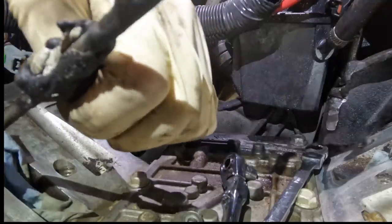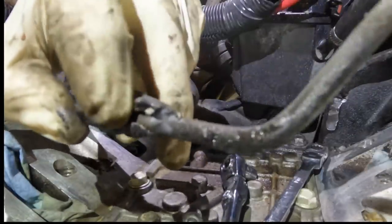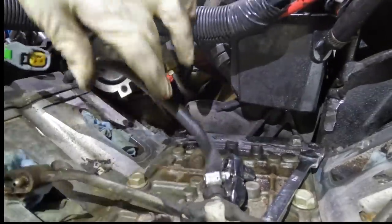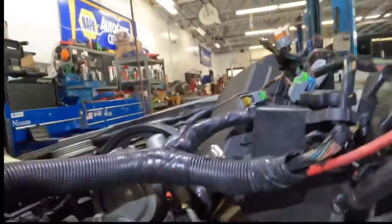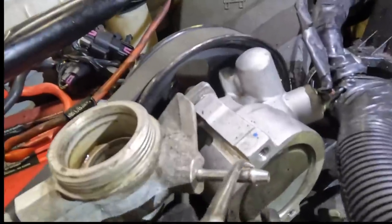You see how that's left like a T-junction type fitting — here's our repair. Some kind of tape or JB Weld, or both. We can see right here at the bottom where the coolant was still seeping out. That crossover pipe connects right up here to this barb. Alright, pipe, you're coming with me.